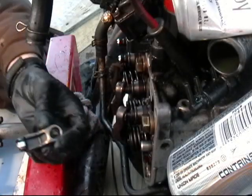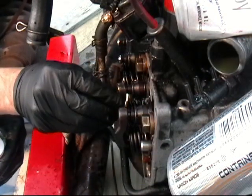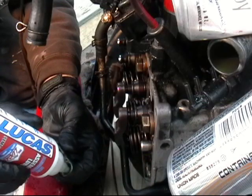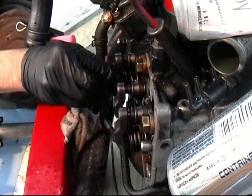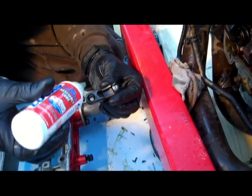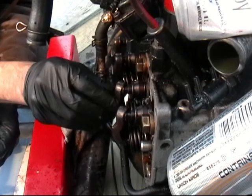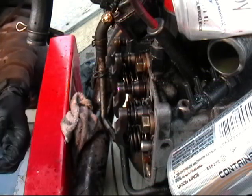We're going to do our rocker assemblies. We're swapping the ones that are original to our donor cams and cam tower so they have the right facing and profile on them. I'm going to put a dab of assembly lube in there and on the end where the valve stem would be, then plug each one in. If you stick it on there just right, it'll kind of suck on and stick there hydraulically. This assembly lube is Lucas brand from your AutoZone-type store. We also want to put it on the face of our cam lobes, as the donor engine hasn't been run for several years.